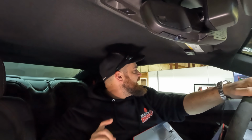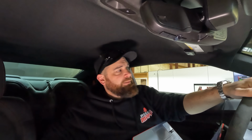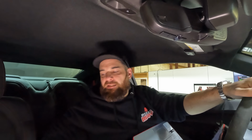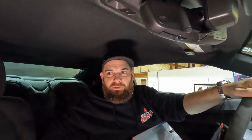I finished it on pump gas already. Made 970 on pump. I have E in it now, and we're going to make some rips on it on E. It's got 56% in it, so I'd like to make over 1,000. I'd love to make like 1,010, 1,015. That's about as much as I like doing on these stock short blocks. Could they handle more? Yes. Do I feel comfortable sending them out to a customer with more power than that? Not really.